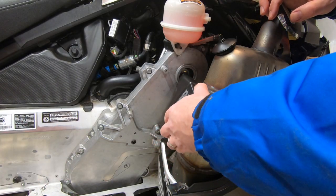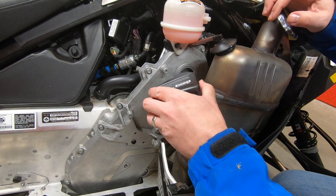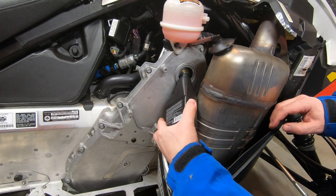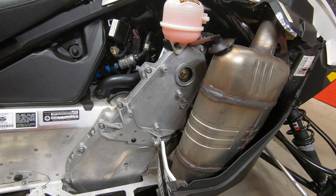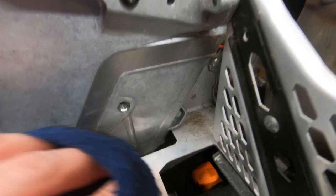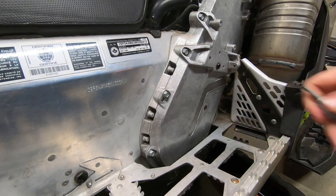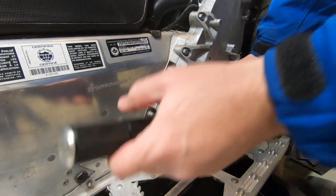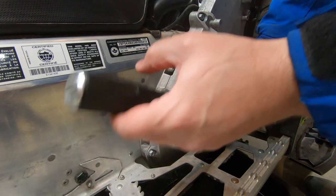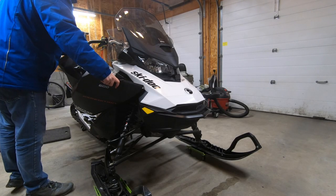It takes about one bottle of XPS oil. We pour the oil into the fill hole until it starts leaking out the check plug hole. There it is, oil draining out of the check plug hole. Once it stops, wipe the excess and replace the check plug, torquing it also to 53 inch-pounds. Now just replace the filler plug before reinstalling the right side cover.